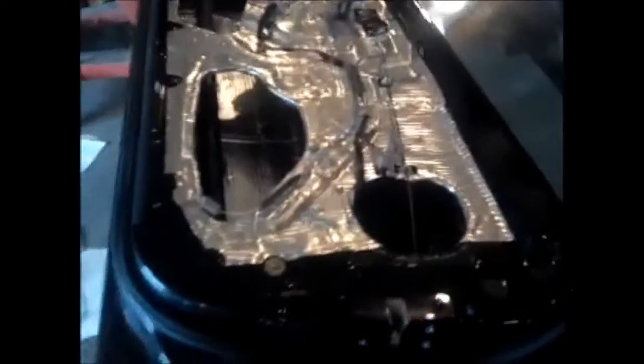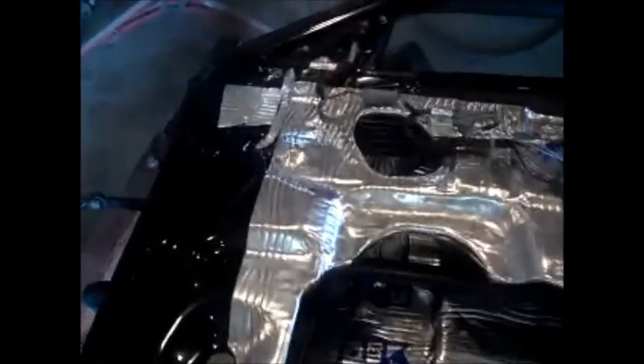When it's done, I want to do a quick video to show you that dyno matting the inside of the door. As you can see, it's almost just about completely covered. Little nooks and crannies that aren't, but that really isn't going to matter because it ain't to seal it. It's just for the vibration, so as long as it's pretty majorly covered, and you can hear it's all pretty solid. Okay. Here we go with the dyno mat finished on the outside, and inside it's all done.